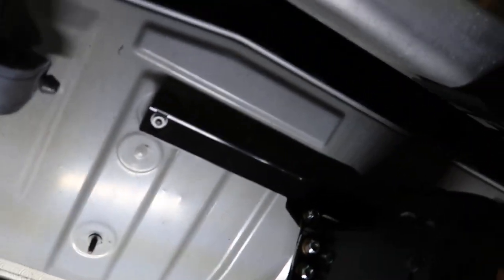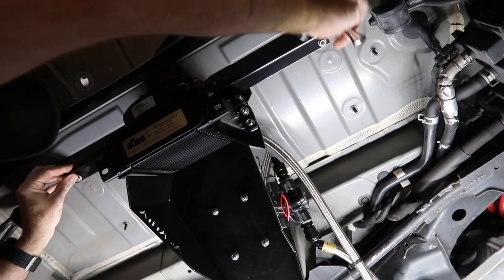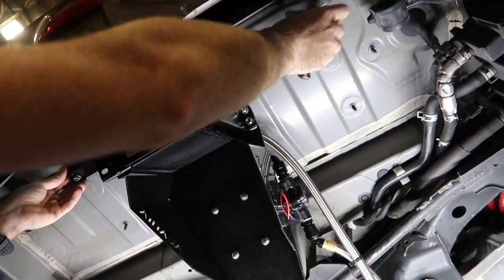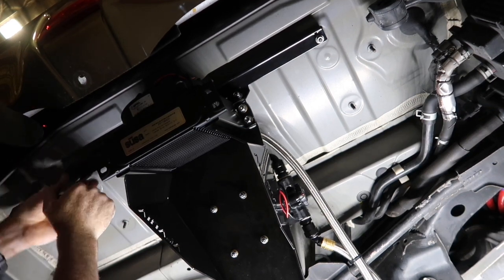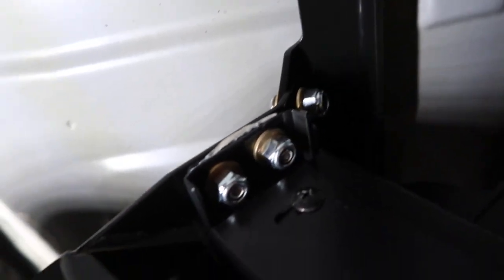It's a little tricky to do — you've got to get the rear mounting point on the studs, all while holding the hardware in place. Get your front bolts started, get the nut started on the rear studs, and it's hung in place. First we're going to tighten up these front bolts, then we can kind of square up our rear brace since the holes are slotted to make things easier. Once you've got it squared up, tighten those bolts down. Then tighten up these quarter-20s that hold the shroud to the rear bracket — that's a 7/16ths nut and a 5/32nds Allen on the other side.